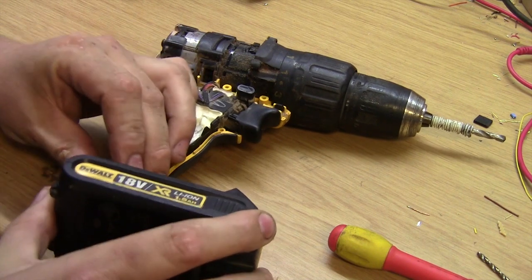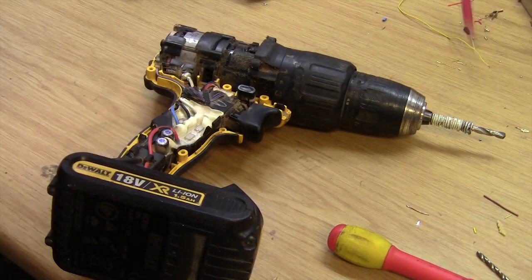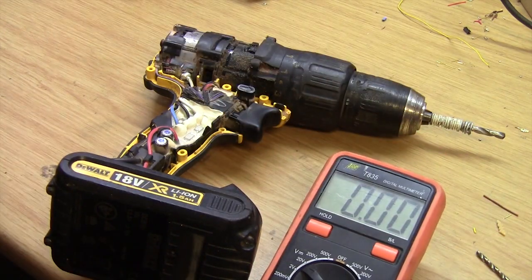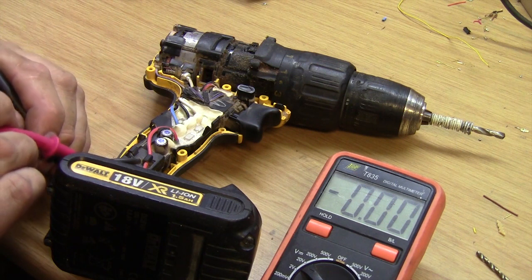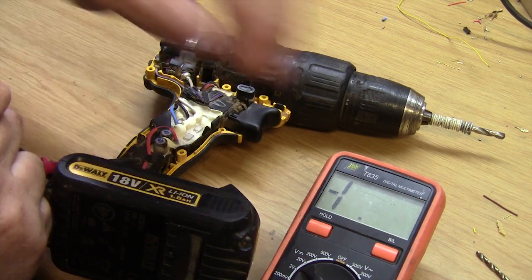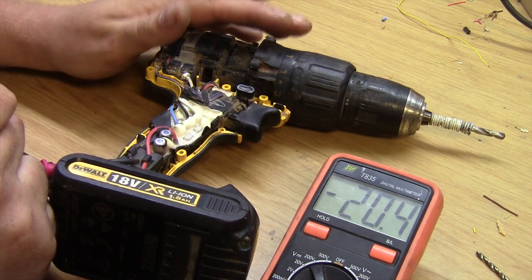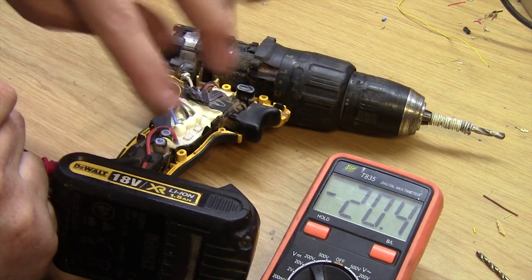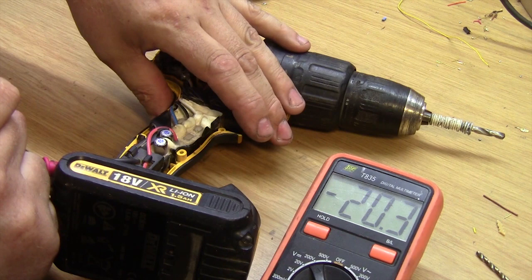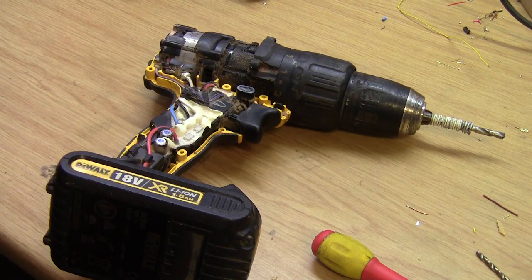Let's hook up the battery — still giving us the light. This battery is good. Let's take a voltmeter on DC volts. I'm going to go on the output terminals of the battery, which is the high-current terminals — basically the terminals for all the cells. Okay, 20.4 volts. Now if there is a stall or something causing this thing to cut out on the current protection, we should see that drop as soon as I pull the trigger. Nothing. Okay, so that means it's not drawing too much from the battery, and definitely nothing wrong with the battery.